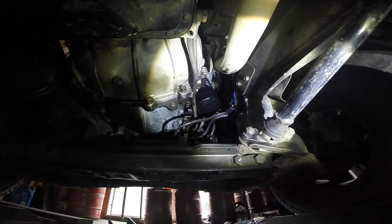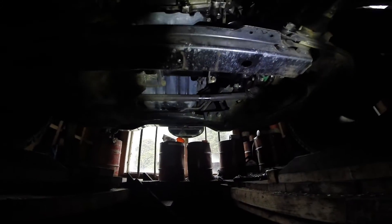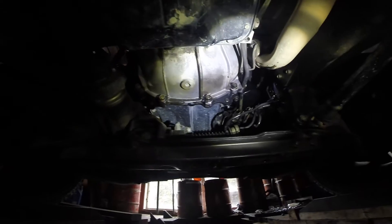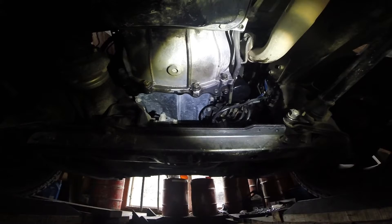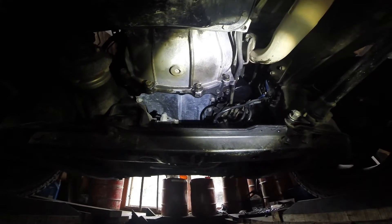That's the new filter I've got on there now. I'm going to throw the bolt back in the sump, throw five or so litres in, crank her over for a few seconds to get the oil around the engine, and then keep checking and topping it up until she shows full.